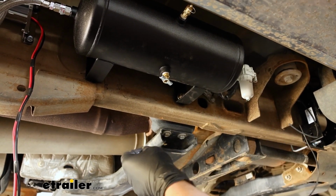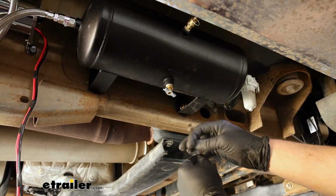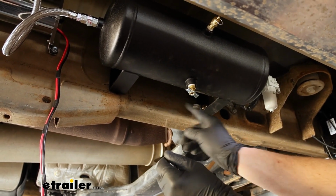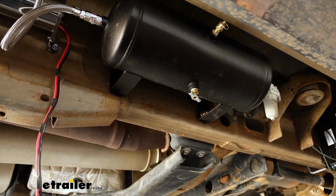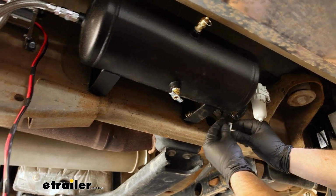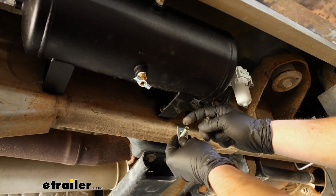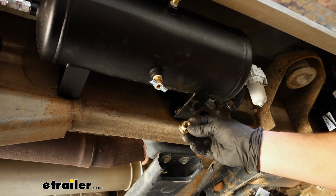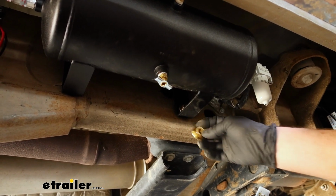And then I had some 7/16 fish wires too. Where the holes were drilled, I took the coiled end of the fish wire, pushed it through the hole, and brought it out through this opening. And then you attach your hardware to the fish wire, right? And then I pulled it back into position so the bolts came out like that through the frame. And then I was able to secure it with the flange nut there.